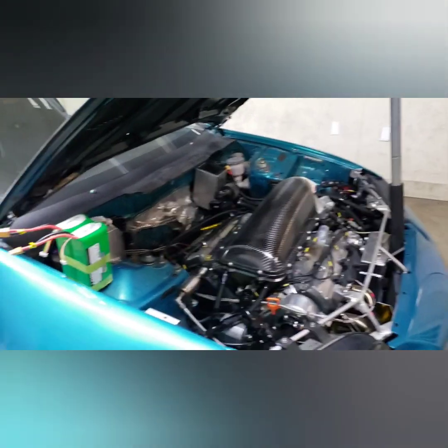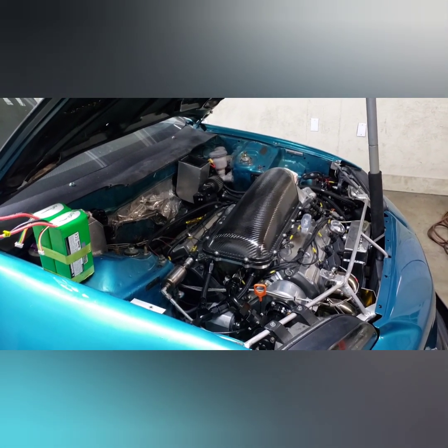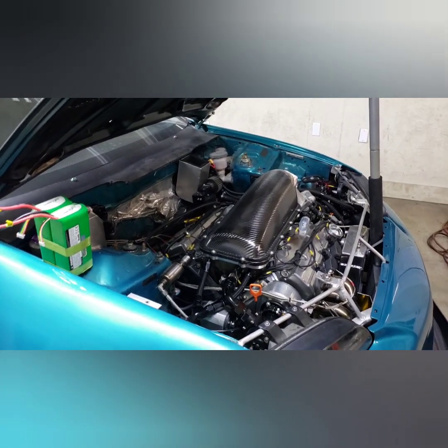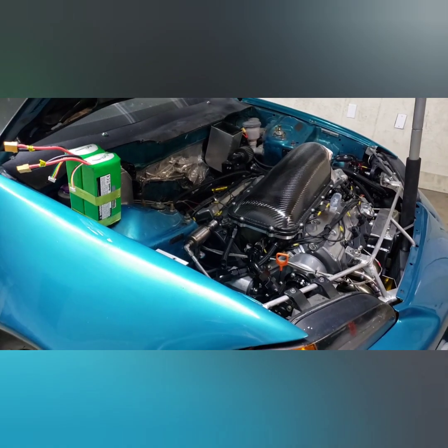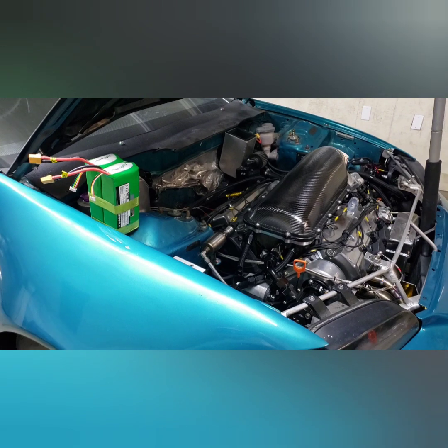To answer your question Steve, one of the reasons there isn't much info on this is because there's just not really much to say. You're running a car on a battery instead of running on an alternator, so we run more voltage than we need — so that as it discharges we're still at 15 volts or more, which would be high for an alternator. That's the main reason to do it — it just removes complexity from the system.